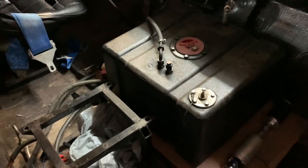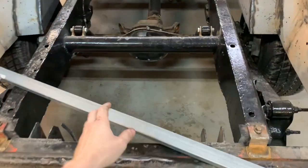It's time to get it out of the cab and get it back in under the frame. My plan is to put the fuel cell in under the bed with no exposed parts at all, far enough down that I can make an extension for my filler cap. I'll make an extension up to the bed so that's the only thing visible — you can just flip the lid, pull it off, and everything will be nice and flush and flat.